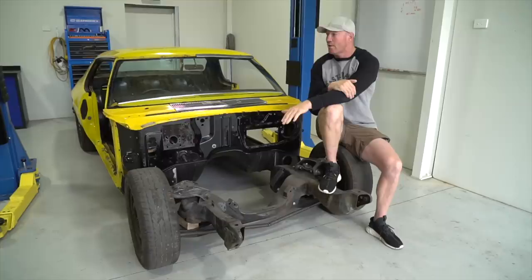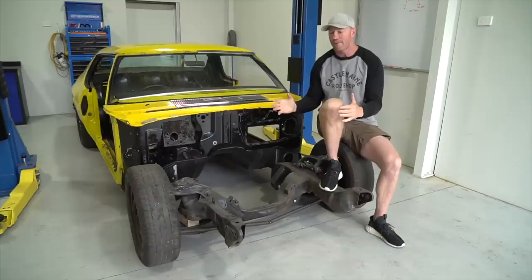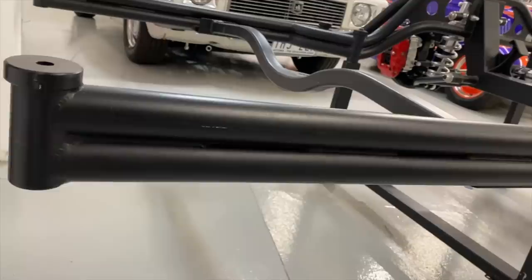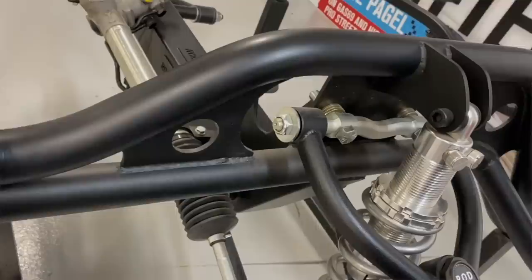So I come to the Castlemaine Rod Shop. They do a fantastic front clip, a chrome alloy tubular front end. As I said, I've got a big block Chev. I've got some really big pipes, you know, 2¼-inch pipes. I need clearance and all sorts of stuff. So instead of cutting up a standard front end, just go tubular. By the time I spend all the money on a standard front end, you're better off going tubular with all the adjustments. The combination I want to go in will go in. Hopefully there might be some juggling and shuffling, but that's all part of the build.